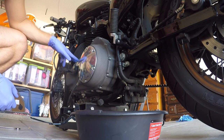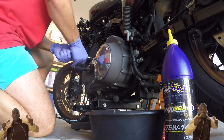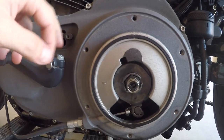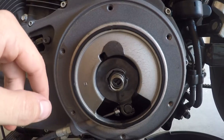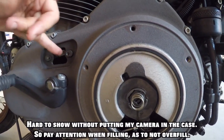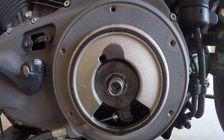I'm going to go ahead and take all these off and then the inspection plates. This is what it looks like when you take everything off — the inspection plate and the derby cover. Go ahead and plug the drain back in. Make sure you don't lose the spring. Start filling it in through the inspection plate opening, filling it up right to where the rim meets, maybe a little bit less, and then put everything back together.